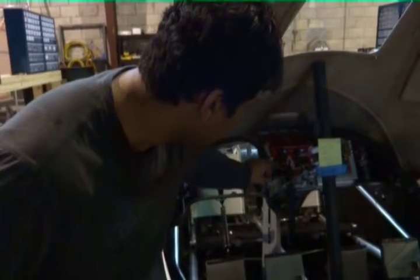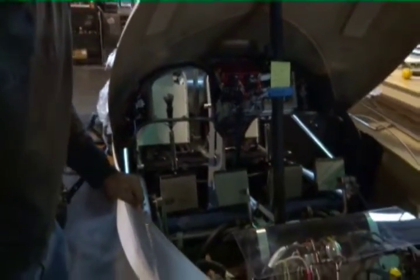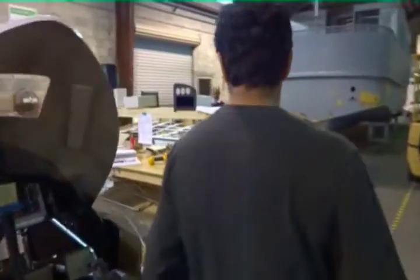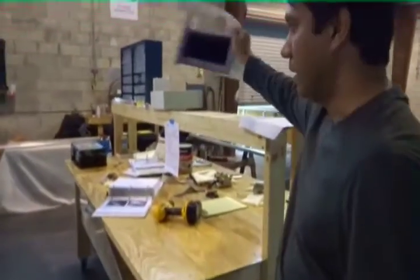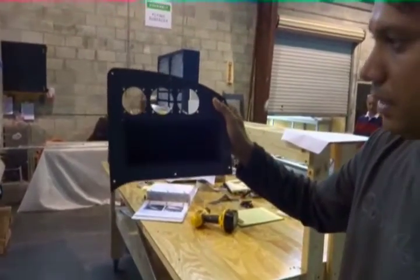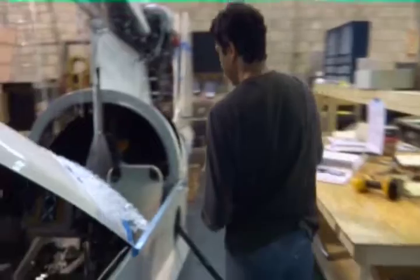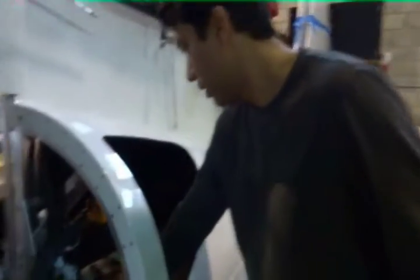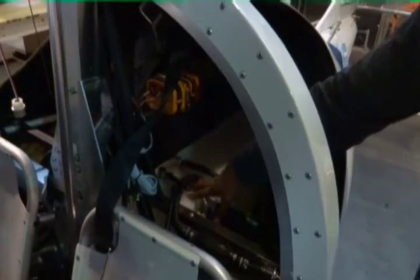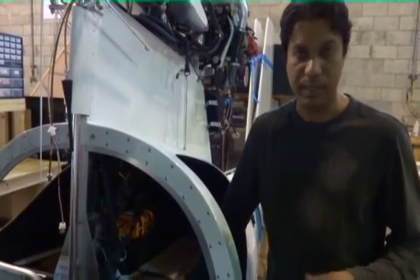All of the buses are right here. The EFIS is going right there, and we have a backup analog airspeed indicator. This is where the glove box will go — you can actually see it, and it's quite deep. You can easily fit a few iPads in there. The fuel tank is a newer fuel tank with 26-gallon capacity, 24.5 usable, and we're making a change to get even more usable. It's a cross-tank polyethylene, so it won't have a problem with ethanol-laden fuel.